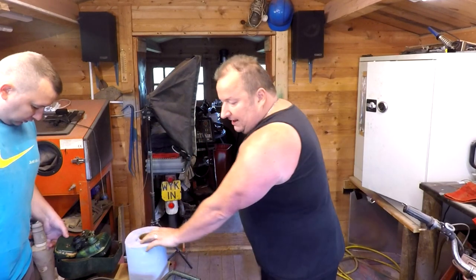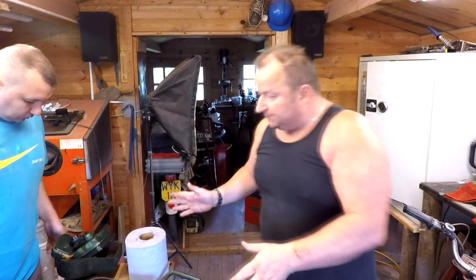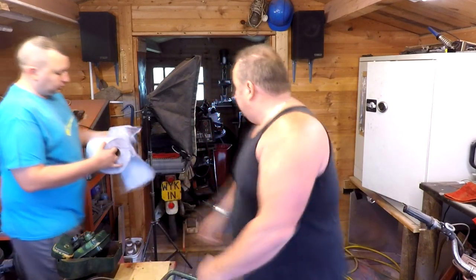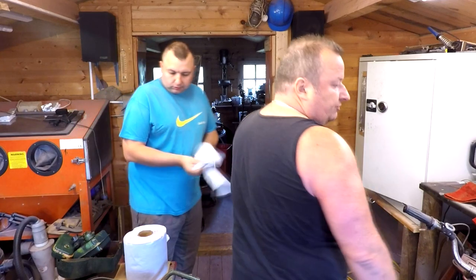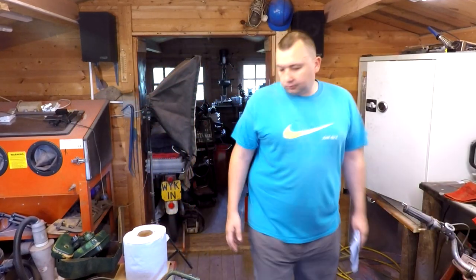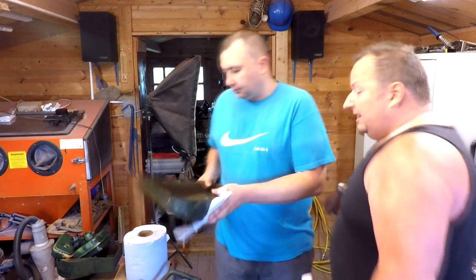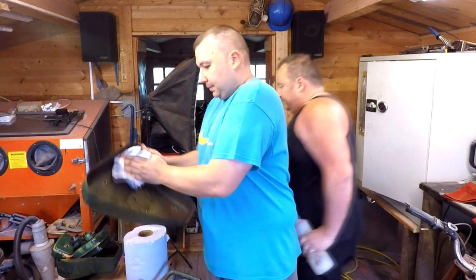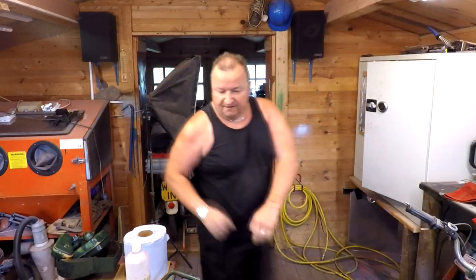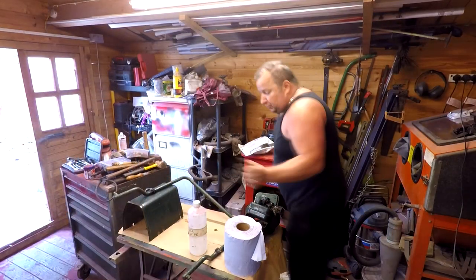Right, you can wipe that out then. You want the stuff as clean as possible. Just get the grease out. There's some degreaser here somewhere. Yeah, panel wipe, that'll do. Do some of that. I'll wipe that out first. Get that wiped out first. And then you can wipe it down with...